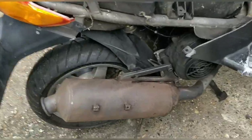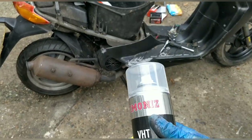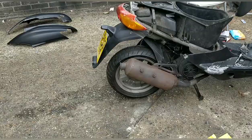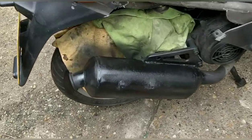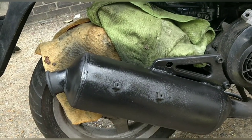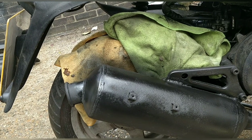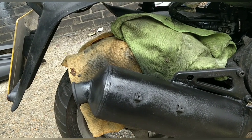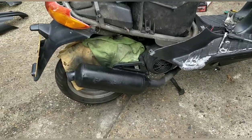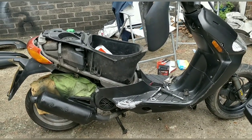Let me get some black on this exhaust — that'll give it a couple more years of protection. Worth doing. This paint costs about a tenner and I did the other exhaust with it too. With high temp paint, you don't have to mess around with tack coats — you just cake it on. If your bike's running, run it for five minutes after to dry it, then wait ten minutes for it to cool and go around again with a second coat. Looks a hundred times better already.